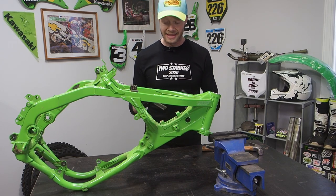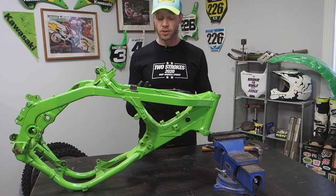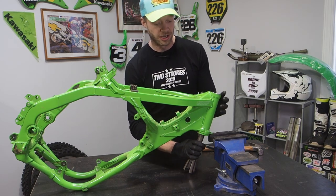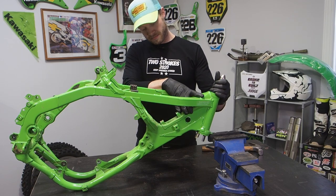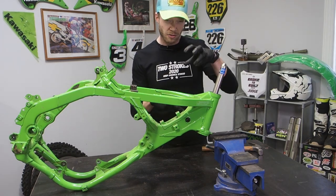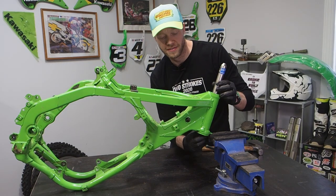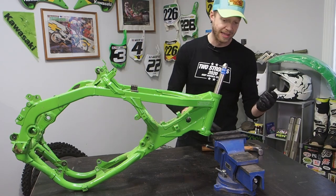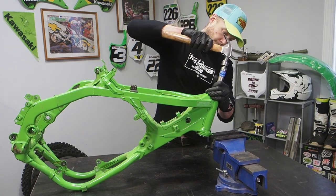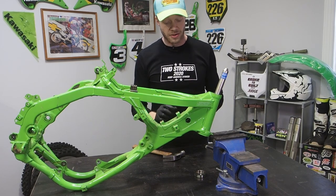The easiest way to get that done — I have this Park Tool RT2 here, I'll link it in my description below. It has four prongs. Basically what you do is just shove it up underneath into the steering tube, pull it through so it clicks in there, and those four prongs will catch on that race. Then it's pretty simple — you just use the hammer and nail this thing out. What was that, four hits? It honestly couldn't be any easier with this tool.